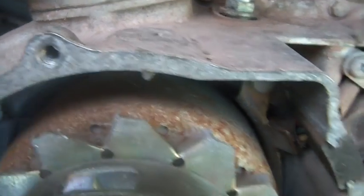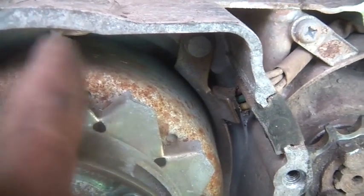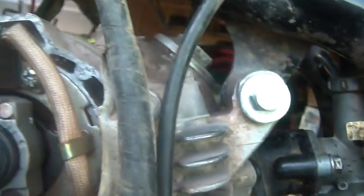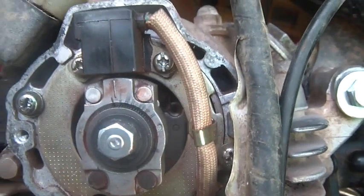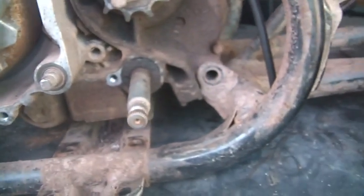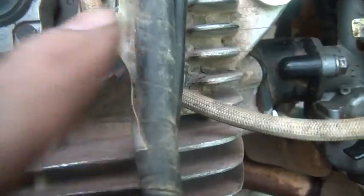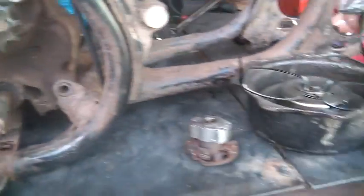That circle with the line between the T and the F - just before the F - you want to make sure you line it up with that. Then you make sure you line up these two lines here, and everybody's happy. You do that first, and by the way if you loosen those two bolts you can move the pulse generator forward and back.